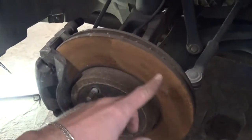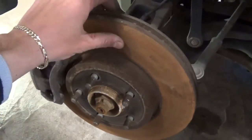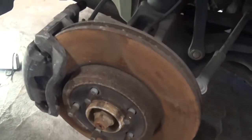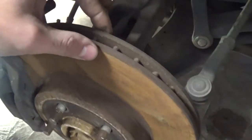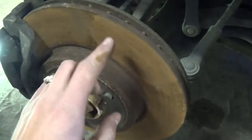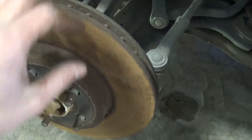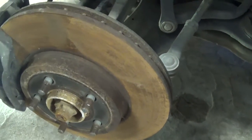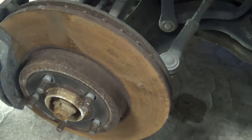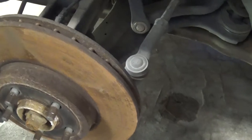This car has been sitting outside the shop for the last day and it's been raining, so it's just surface rust but everything comes off. You always need to inspect your rotors and we recommend going ahead and turning them, cutting them, so they are nice and smooth when you put new brake pads. We'll be putting brake pads from a parts car — this is a temporary deal until we get a few things fixed, and next time we'll put brand new brake pads.